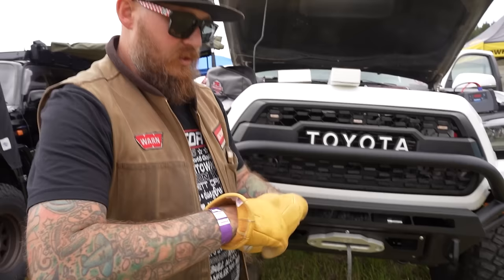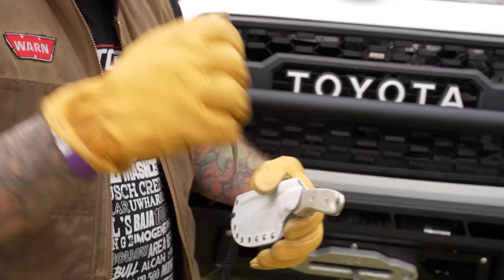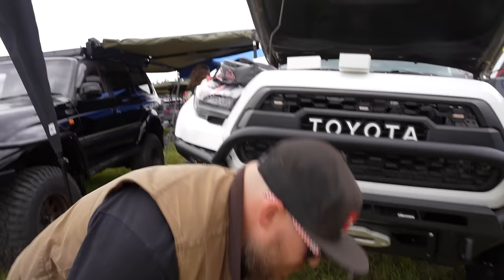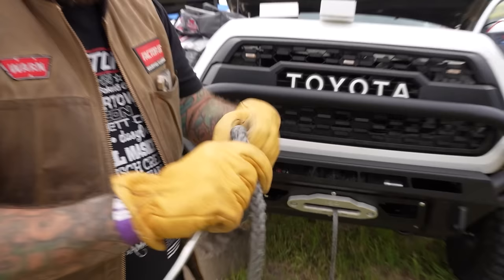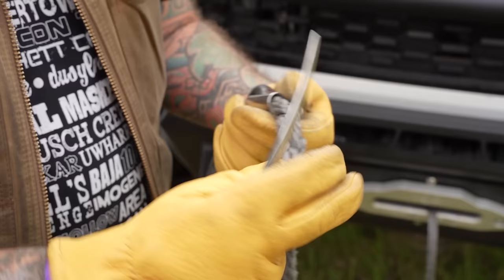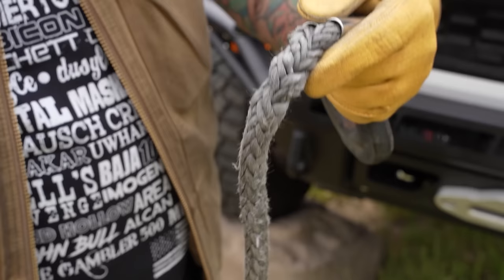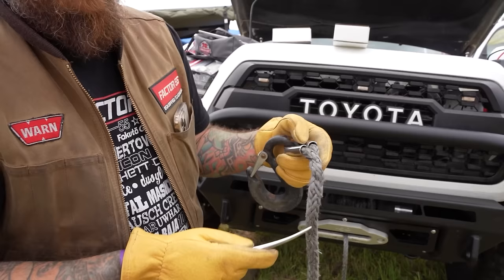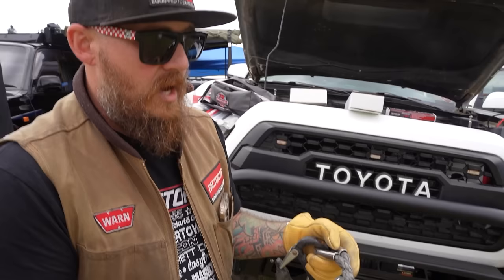This right here is called a Marlin spike. A Marlin spike is used to pry knots out of rope and get rope loose if it gets knotted up, or to get through a splice. Most winch manufacturers now do a splice called a Brummel lock. A Brummel lock locks the eye so the tail that's buried down inside here — you can feel where it tapers off — bites down onto the line. When you do a Brummel lock, you don't need as much rope buried to provide breaking strength, but it's anywhere from 10% to 15% weaker than a traditional deep bury splice.